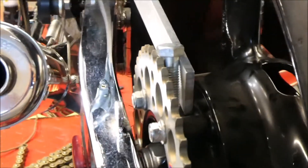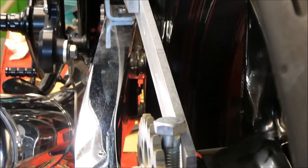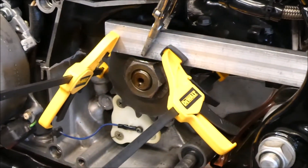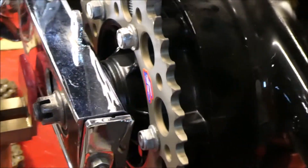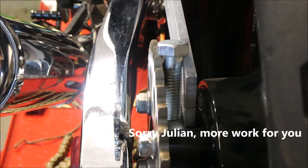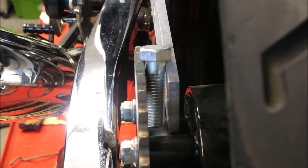This is a little sad. I guess I didn't check the chain alignment on this thing. This is my tooling to check — not too fancy but it does the job. But yeah, I'm way off. I'm going to have to get a half-inch offset counter shaft sprocket and get this sprocket carrier machined down. Let's see if my friend can machine it down — he's done several of these for me. That's a half-inch bolt I set in there just for reference. Darn it. So I've got a little work to do here.